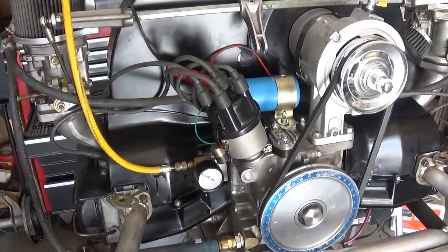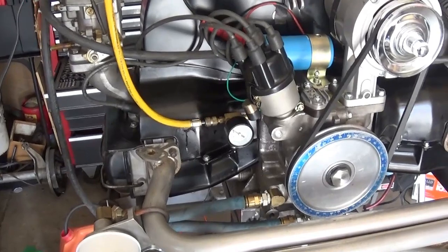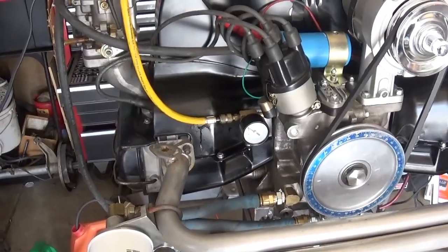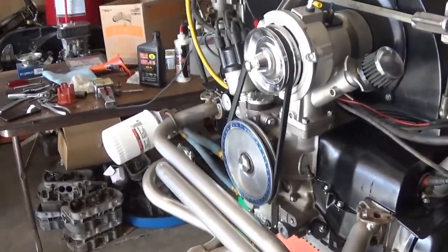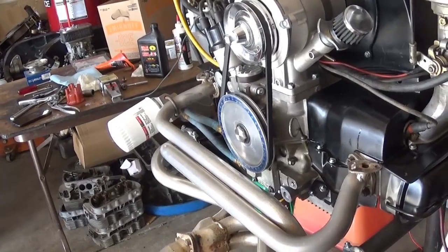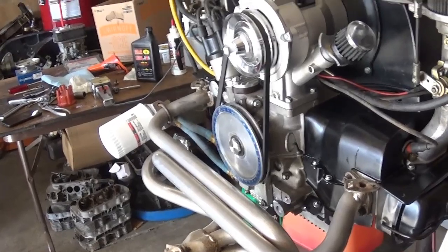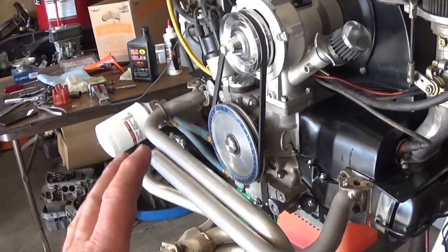I've learned a lot. I want to complain about everything that was aftermarket on this thing, but it doesn't do any good, and it is what it is. If you're just entering into this sport, I really strongly suggest you get yourself the stock 1600 and take it apart, clean it, inspect the bearings, and do a minimal type of overhaul before you move up to these stroker motors.